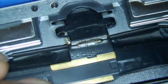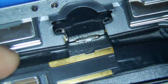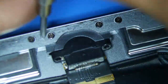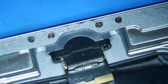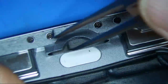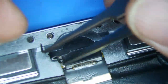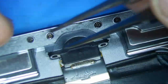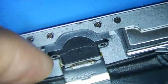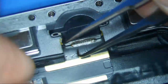I have an iPad 7th generation here with what looks like a bad charge port. After all these iterations of the iPad, I can't believe Apple still hasn't fixed this charge port design. These two screws hold a little metal bracket in place, and what happens is those screws back out a little bit, so this metal bracket wiggles, which usually causes breakage in the flex right here.